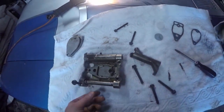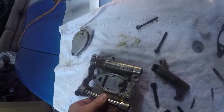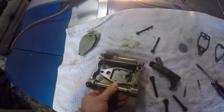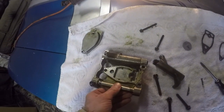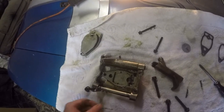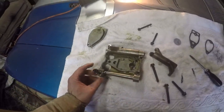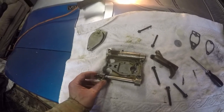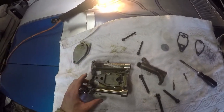Pretty sure that's where the noise is coming from, and it makes sense. It wouldn't be too noisy right now because everything's cold, but as soon as my bike warms up, between about 1800 and 3000 RPM it gets noisy no matter what load situation — clutch pulled in, clutch out, full throttle — it doesn't matter, I can hear it.